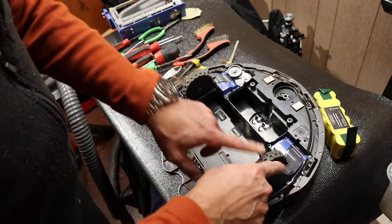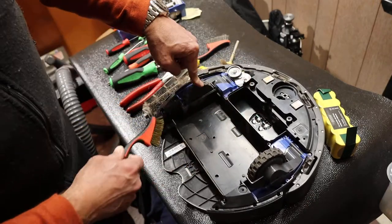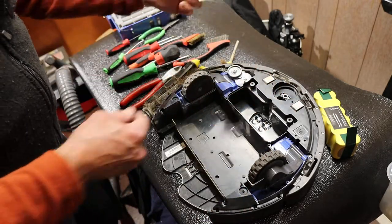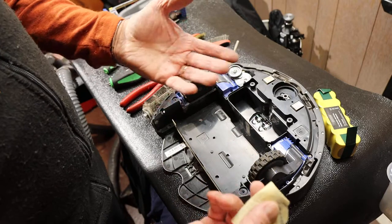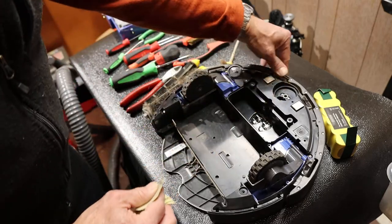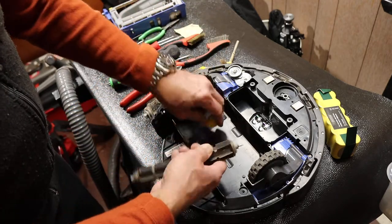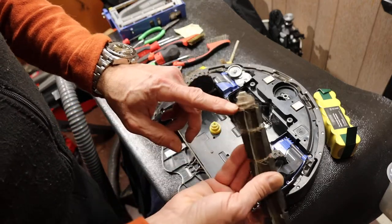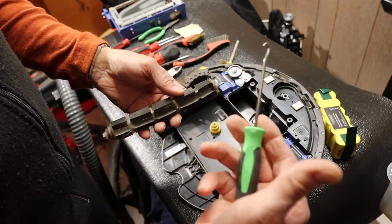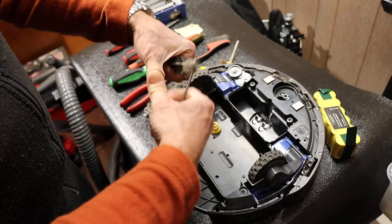Now that it's apart I need to clean the individual pieces. I'll go in with the vacuum and a brush — probably the brass brush — loosening up the dust and dirt all the way around. These are the contacts, so I'll take a little piece of emery paper and do a light polish to help the contacts. I'll also do that on the charging base. For the wound-up brush roll, my best tool is the little hook pick — I can grab onto the pieces and use a bit of isometrics to pull them out.